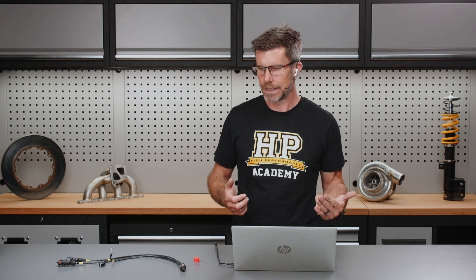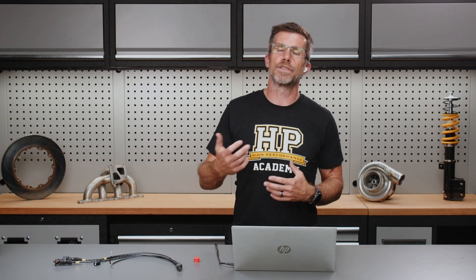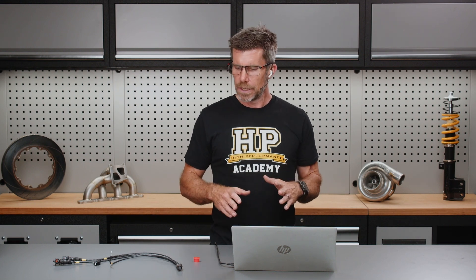So how do you make 15 amps go into 5? Obviously it doesn't. And because this connector only uses size 22 contacts, we're limited. There are autosport connectors with mixed size contacts, but that would still require 14 or 16 gauge wire through the harness, which gets a little cumbersome — particularly when you're trying to concentrically twist. The easy solution, which is often overlooked, is to simply run three 22-gauge conductors out to the starter motor and split the load. Three times 5 amps gives us 15 amps — our current handling capability for the starter motor.